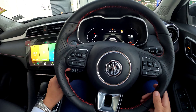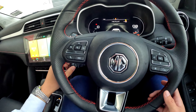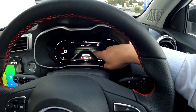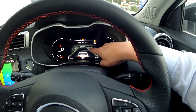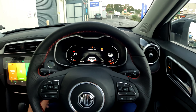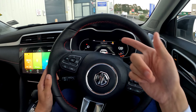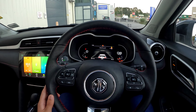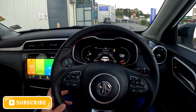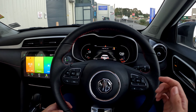Once you start driving, you'll be able to use the switch — twist it forward or backwards to change your distance between you and the front vehicle. In this instance, we have the full digital dash, so we're going to see the bars at the top right. You can see the bars: three, two, and one — that's your distance between you and the front vehicle. Roughly one bar distance is about two seconds, and three bar distance is about four seconds — that's your safety distance.